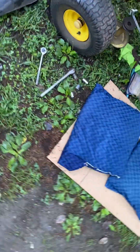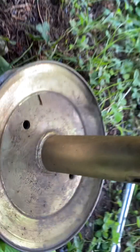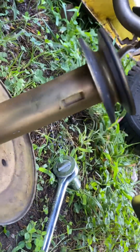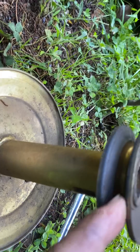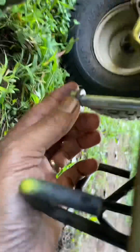Either that piece has to be replaced as well because it looks pretty worn out. Now, you remember I told you this drive belt is all cracked and broke. The only way you're gonna get this drive belt out is this pulley — the one bolted directly underneath the motor. That bottom pulley is used to drive the mower deck, and this is your drive belt pulley that helps your ride mower move. So this bolt has to come out.